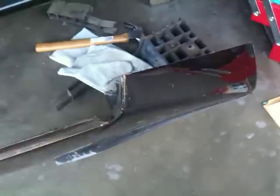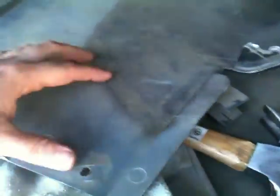Okay. Now, just before I sign off, the ground effects brackets that normally fit on there, you'll notice that they don't really become too friendly when it comes to the underneath of the front nose. They'll actually come quite forward on the nose. So you can either cut those excess parts away, or you can get this part and lip it underneath the front nose, right under there when you install it. But be warned, it's quite a task to do that as well.